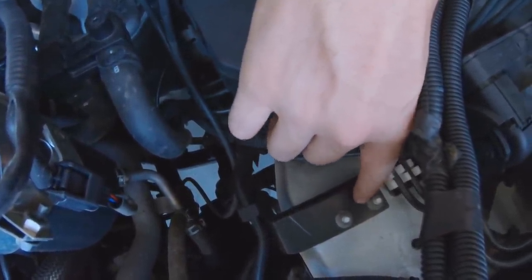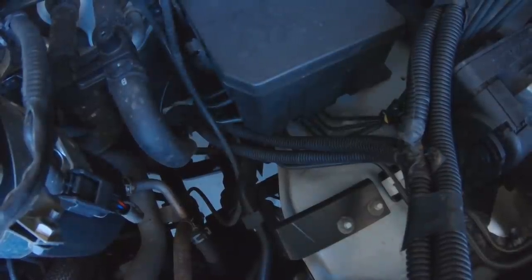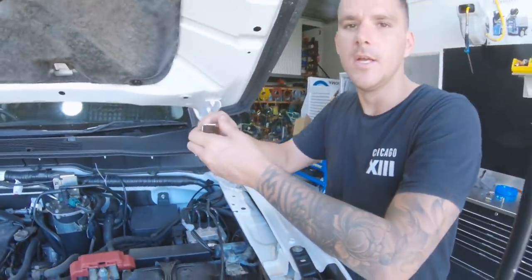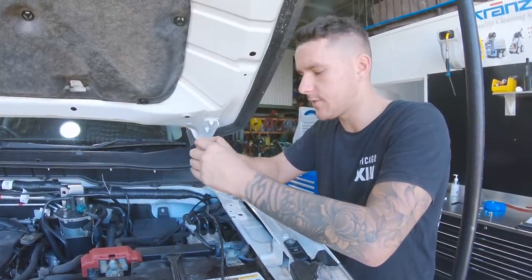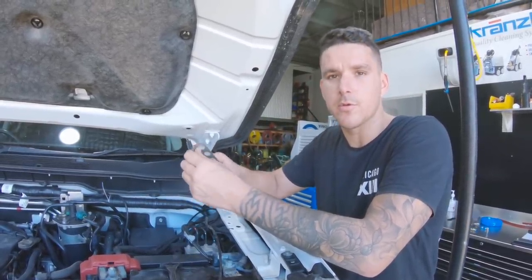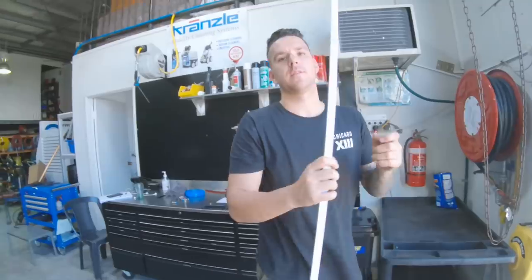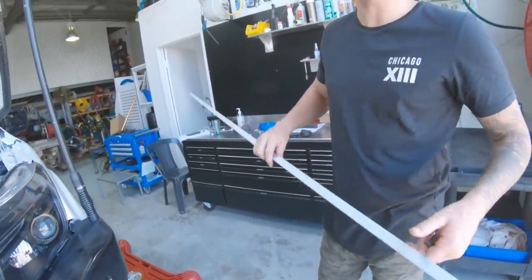Those are just like an 8mm bolt or something like that. What I'm actually gonna do is fold a bit of aluminium just 90 degrees and use those two bolts to mount it just there - it's nice and high, gonna clear everything, and then the lines can just run down there. I've got a bit of aluminium strip that's just gonna take a vice to bend it. Then I'm gonna mount the plate to the aluminium strip using small bolts - it'll look really neat. I'm pretty happy with that location so we're gonna stick with that.